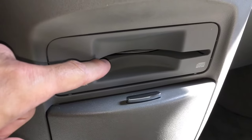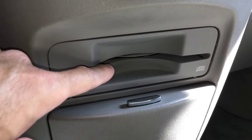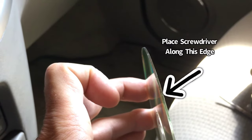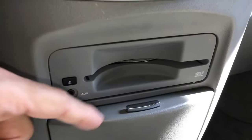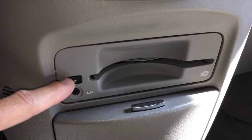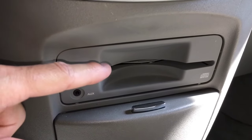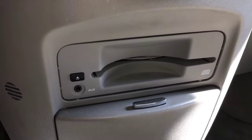I'm going to take a very small screwdriver and put it on the edge of the CD itself. We're going to gently lead it out as we push the eject button. With the player trying to push it out and us gently leading it out, that should get it out.